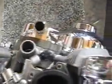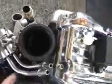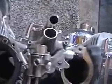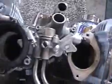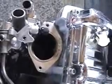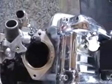First off, I have to get the remaining throttle body fuel rails assembly off the top of the engine. This is the rubber boot that's on top — take the two bolts on the top and bottom, loosen them up, and pull them out of the way. Then the third bolt toward the inner center of the engine is the bolt that holds it to the throttle body.